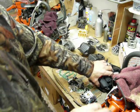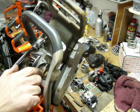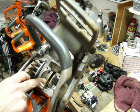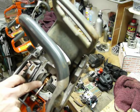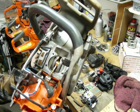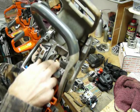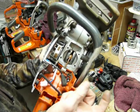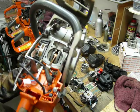If we want to look in at the crankcases themselves, they're both the full circle crank variety. Technically full circle, they're really caps, they're metal caps. They actually have some nylon pieces that are designed to fit in there, wrap around the top of the crankshaft, kind of butt up against the throws right there, kind of where the journal area is, upper part of the throws technically. But you can see how we're trying to pressurize this area. What the full circle cranking concept does is it takes up volume, so your pumping ratio increases, helps them run better, which is a nice feature. Actually helps them be more efficient as well. But you can see how we're directing the flow underneath and how it comes up through. That's the start of the transfer port circuit.